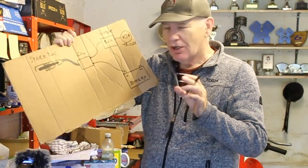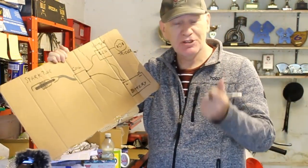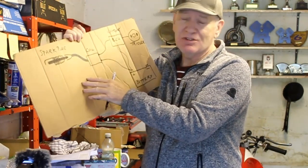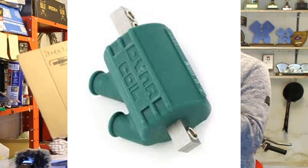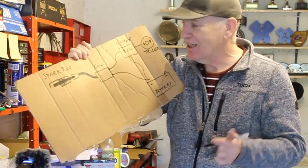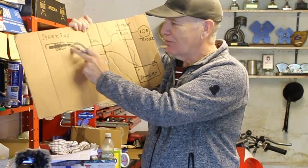When it comes to coils, often what you have is what's called a lost spark ignition system. So if you have a four-cylinder engine you have four spark plugs, but normally you don't have four coils — you only have two, because each coil drives or powers two spark plugs. It's called a lost spark ignition because at any one time one of those sparks fires when there's no fuel-air mixture in that cylinder to ignite. But let's keep it simple and imagine we've got a single-cylinder motorbike: one spark plug, one plug cap, one lead, and one coil.